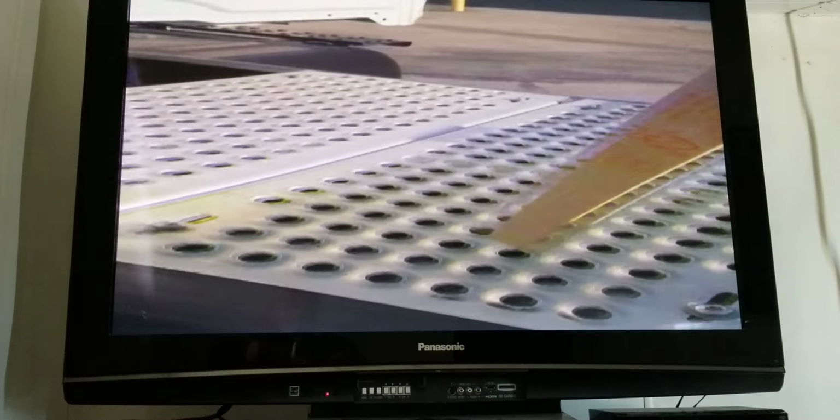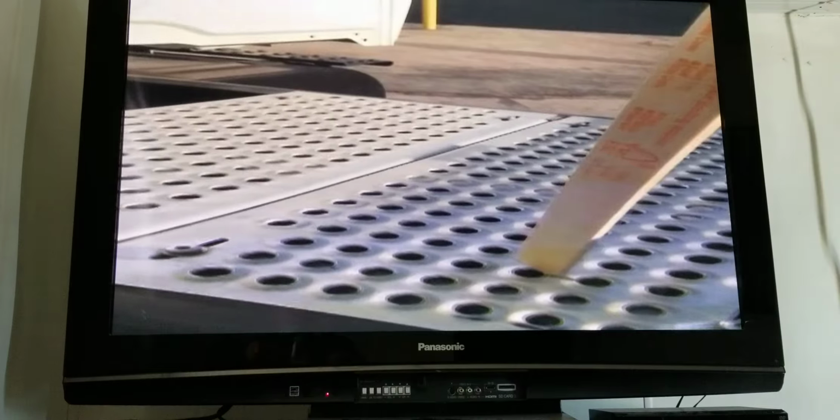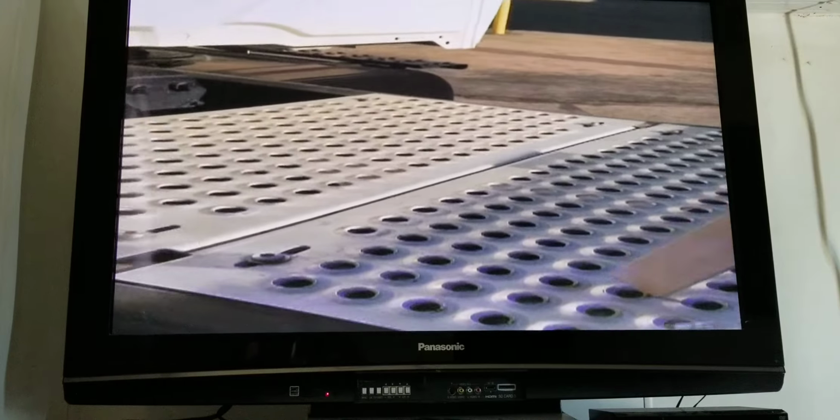I have my tractor frame and cross member. It is properly mounted. There's no loose or missing bolts, no bends, cracks, or any illegal welds, and no extra holes. I have my catwalk. It is properly mounted. There's no loose or missing bolts, no bends, cracks, or any illegal welds, and always clean.